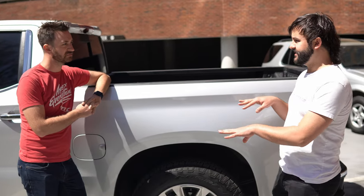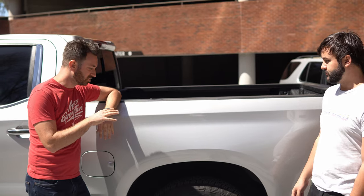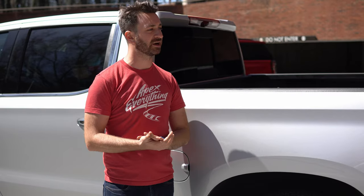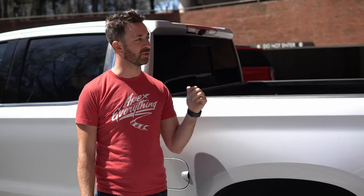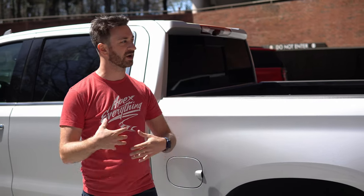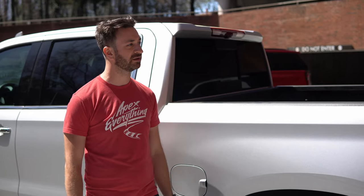On the Z71 with all-terrain tires — GM rates this truck to tow what it's rated for with these tires installed. But if you care about how the truck feels pulling a trailer, all-terrain versus highway tires matters. All-terrains have a lot more space between the tread blocks. If you have a really big camper or a large enclosed box trailer and want to reduce how squirmy it feels, you're going to want a highway tire. Less space between the tread blocks means less room to shimmy at highway speed. For maximum control, your best choice is a highway tire with a high load rating.